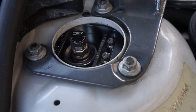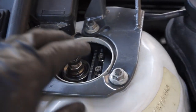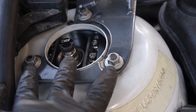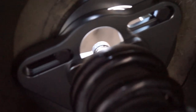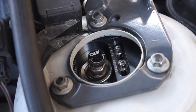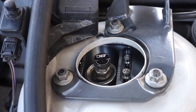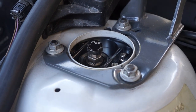I have it installed here now, and even though it doesn't look very different from this position, let me explain what this means. Having the caster plate in here with the camber adjustment means I can still adjust camber, but it also means I have adjustment for caster — for where the strut sits relative to the fender. If you look underneath, you can see that they are slotted on the sides, giving me the left-to-right adjustment I need. Alignment shops generally love when you have the factory adjustments built in, since they don't like aligning cars that have been lowered. This just makes your alignment guy a little happier.